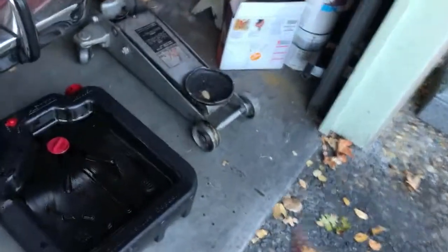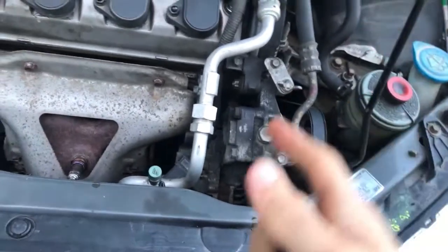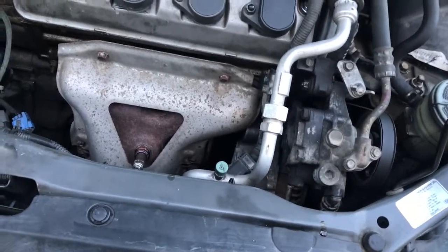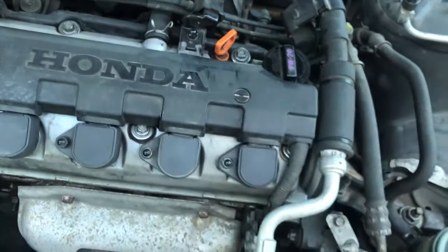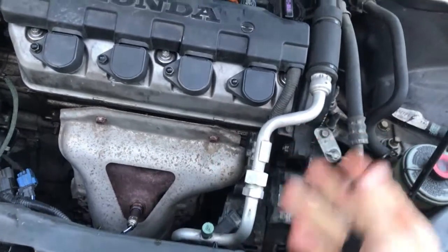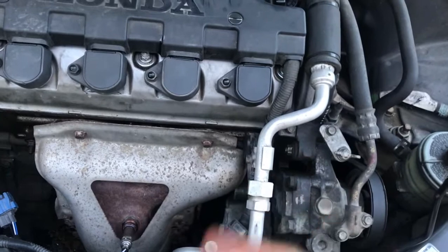The first thing you're going to do is jack up the car. Make sure it's off, and you don't want to do this right after you've driven because everything's going to be really hot. Give it about 15 minutes to cool down. Jack the car up, put stands on either side. You will loosen the 17mm bolt on the bottom of the drain pan and also remove the oil filter. People recommend changing the oil filter with every oil change — Fram filters are about four bucks on Amazon, so just do it.